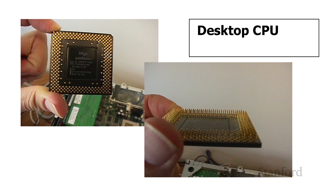Imagine: we've got the CPU connected to main memory and the CPU needs to access data from main memory. A whole bunch of these pins are going to send address information — setting the address pins saying, this particular sequence of bits is the address for the particular byte in memory I want to access. Then either memory sends the bits at that memory location through the data pins and I store that in the CPU, or the CPU says I've got information in an internal data register and I need to store it in memory — so I set the address pins and send the data through the data pins.